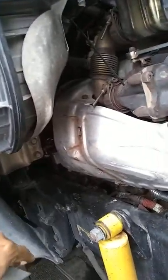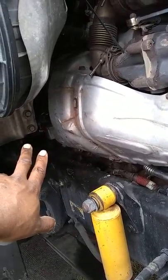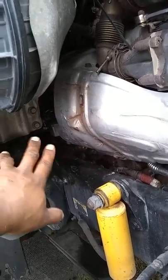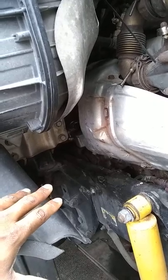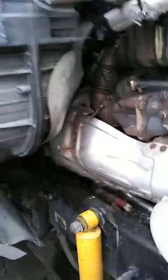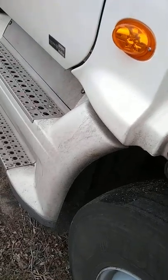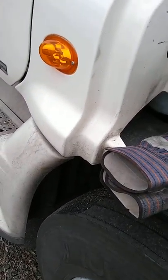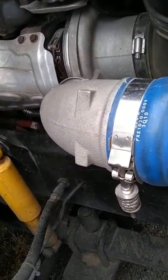Remember this tube — you have a clamp on there right behind the compound turbocharger, but you also have two bolts that go in toward the back of the block with the bell housing. You're going to think you could just take that clamp off and remove the clamp from the back of the bellows going back to your one box, but you actually have to remove those two bolts too. They're kind of blind bolts. In order to do the job right, take all the cladding and heat shielding off, remove your fender, your step, and your fairing so you can get access to your bellows and the other flex pipe that's up under the truck. Pull all that off, take the bolts out the back, and then you can finally get enough access to move that pre-bent aluminum line into place.